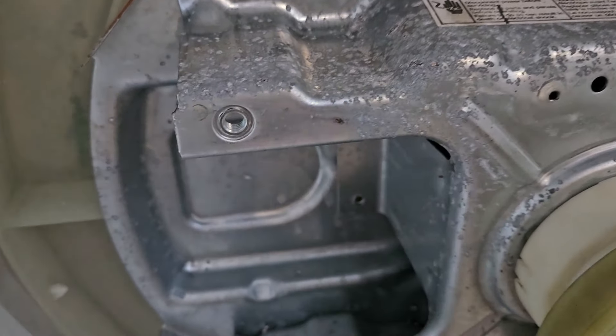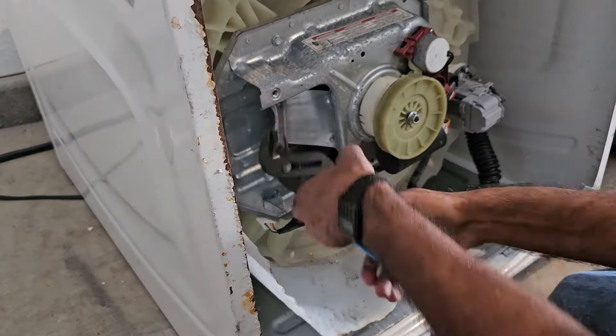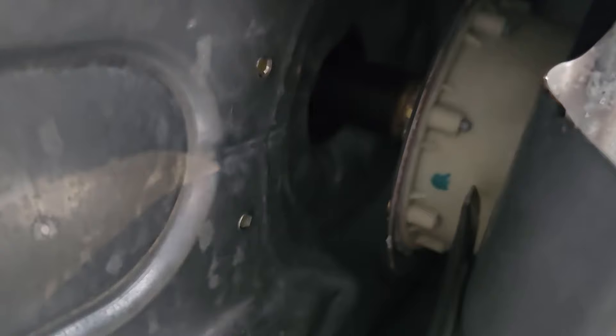I'm going to grab this flap right here — maybe with some pliers or with my hand — and pull it towards myself. I've got the tab pulled back and I've marked where on the transmission oil reservoir we're going to be drilling. If you see that blue mark right there, it doesn't have to be exactly there, but you want it near the top of the oil well and not at the bottom, because that's where the gears are. I've opened this up in one of my other videos — I can link that in the description. You don't want to drill down here; you want to drill up here because it will clear all the gears.